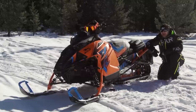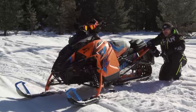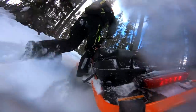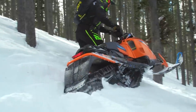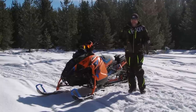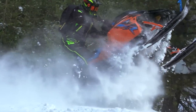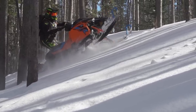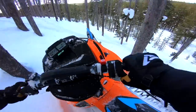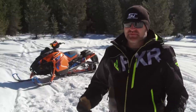So if that's the case, just how good is it off-trail? With Arctic Cat's C-TEC2 800 SDI engine under the hood and a 2.6 by 146-inch Powder Claw track out back, it definitely likes to get the front end light — in other words, it's a bit of a wheelie monster, which is fun when you want it to be, but you really have to ride with your weight forward to keep the nose from constantly wanting to go up on steep sidehills. Because this sled is shorter, it doesn't have as much flotation as a longer mountain sled, so you really have to ride it aggressively with lots of throttle to keep it from getting stuck in the really deep stuff. Today's ultra-long mountain sleds can be almost too easy to ride, but the Riot X 146 brings back some of the challenge to riding in deep snow. It tests your abilities and allows you to push your limits on terrain that a full-length mountain sled would pretty much just laugh at.